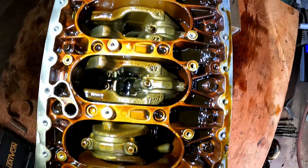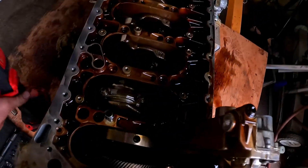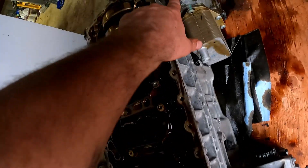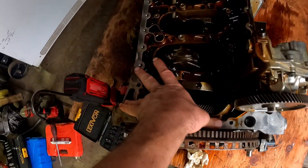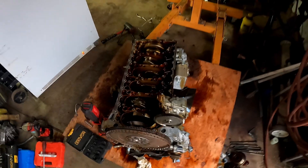Let me get a flashlight. As you guys can see, it's pretty burnt oil — somebody did not really do a great job with changing oil on time. But I'm probably going to leave it like this for now until I get the rods and pistons made. I'm going to organize everything — I put them in Ziploc bags, kind of tie them together to stay organized. I don't have an engine stand, but by the time I'm building it I'll probably have one. I'm going to have to unbolt the oil filter housing and unbolt the cradle that holds the crankshaft, remove it, then remove the crankshaft, remove all the rods and pistons — stock ones — and insert the new ones.